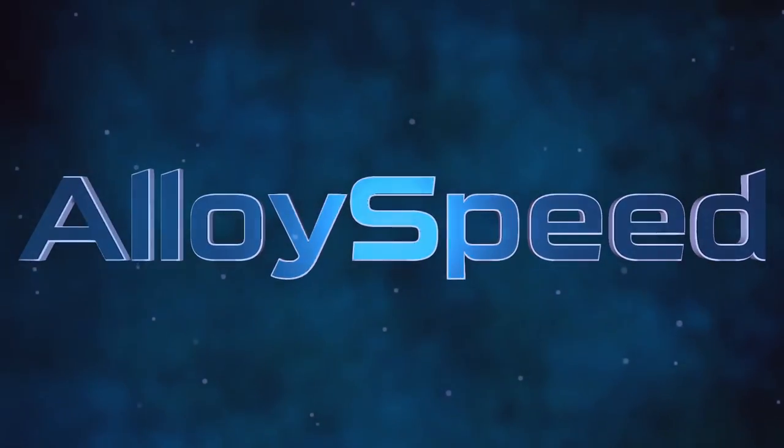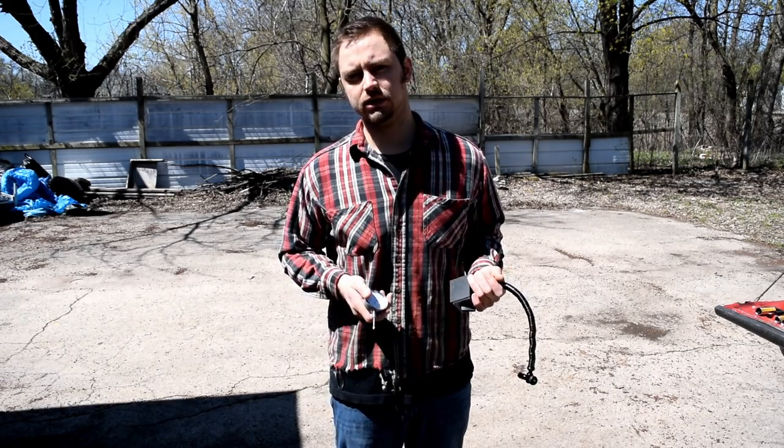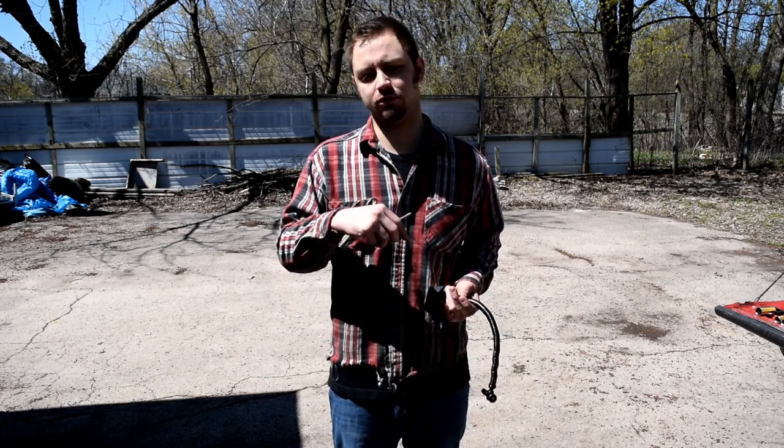Welcome back. We're gonna tear down the Turbo 400 for the Camaro build and have a look inside — it's probably pretty gross. It needed a rebuild; the outside doesn't look good and the inside doesn't look good either. We're going to check the input shaft lateral play on the torque converter side, write it down, and check it to spec. I think the spec is around 80 thousandths — I'll have it correct in the description.